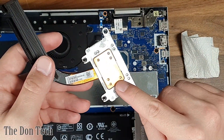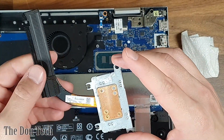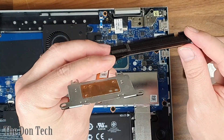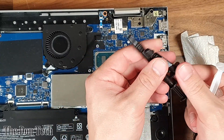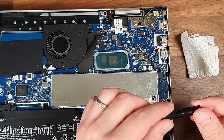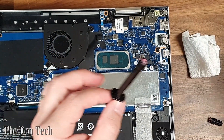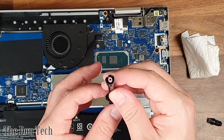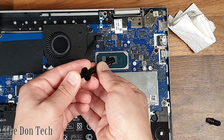So now, as you can see, we have all the thermal paste cleaned off of the heat sink and the CPU. There might still be a little bit of residual thermal paste on the heat sink in the crevices — don't worry about that, that will not be a problem. You can also take this opportunity to look through the vents in this cooler to see if there's any built-up dust or hair. This one is pretty clean, so I don't even need to worry about cleaning this at all. For thermal paste, I've got two different types: Thermal Grizzly and Corsair. For this particular one, I'm going to go with my Thermal Grizzly thermal paste. This should give the best cooling performance out of any that we have, and I would 100% avoid liquid metal. We're going for a tiny X that will cover the CPU as a whole, but dots will probably work just fine here.